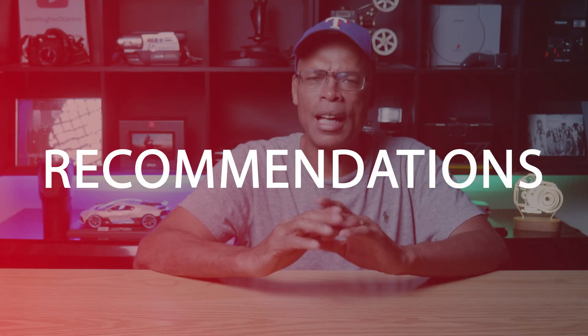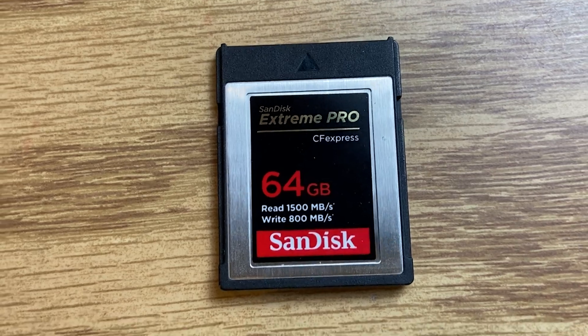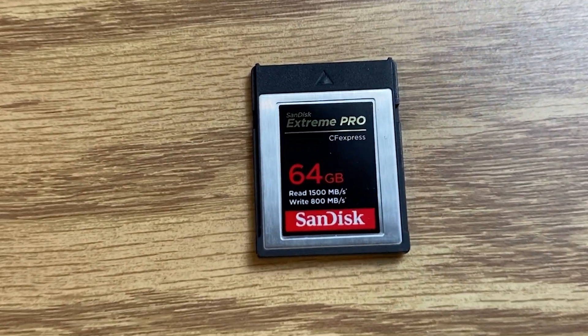Now for the recommendations. Most hybrid cameras made today have a 29-minute limit, basically to help the camera and battery cool. Newer cameras like the Nikon Z9 don't have this limitation. First, use the correct memory cards — newer, faster cards with better heat dissipation from the compatibility list. Turn off your camera when it's not being used; if you're in between events and have a moment, turn it off. Between recording cycles, change the battery so you have a cooler battery and the camera doesn't accumulate as much heat. Don't use your camera in extreme heat — in Texas it can reach 100 degrees, so I do my videos indoors or during golden hours when it's cooler.